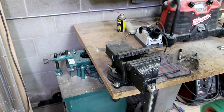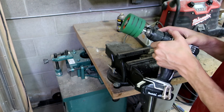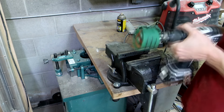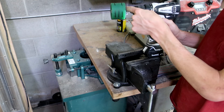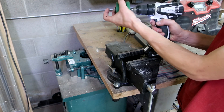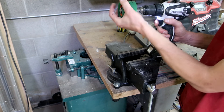You could do this in a drill press or a lathe and that would be better, but I figured the tool most people have access to is going to be the drill and the vise. It could be a corded drill but cordless will be more convenient. I'm having it stick out the left side of the drill and I have it in reverse, so the top of the wheel is coming towards me and pressure on the wheel will cause the nut to tighten instead of loosen — if you have it in forward it will just come off.